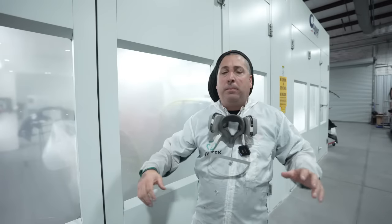All right, so now with the base coat, you guys can see the big difference is you go in there one time. It's called one visit. So you put your coat on and then you pull back and you put another medium coat to lay out the metallics, and that's all you got. So we spray the wet bed. That's the same as the original PPG we were using here. But then you go right into your color coat and then you finish the job out.